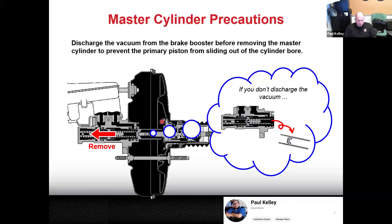Now you have to replace that. If you're on the job, you're going to replace that master cylinder. If you're in class with me, we're going to take it, clean it really well, make sure there's no defects, put the correct type of lubricant on the seals, and essentially put that master cylinder back together. But that's my decision, and we're on lab cars. On a customer car, even if it was me, I'd have to call and say, I went to do your booster, and now it needs a master cylinder. And if I'm honest, I'm going to say it's my fault. And if I'm dishonest, I'm going to say, I couldn't believe it, when I got in there, I saw this was all so bad. But that's lying, in case you didn't know.